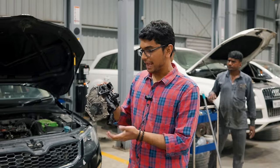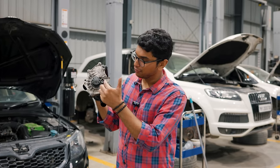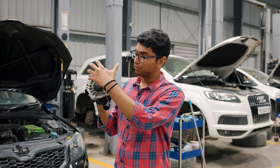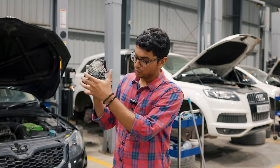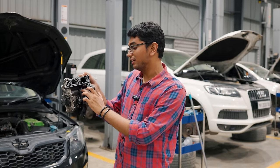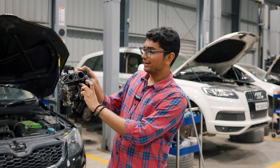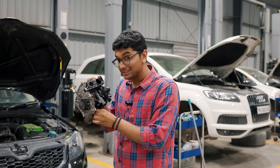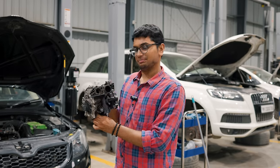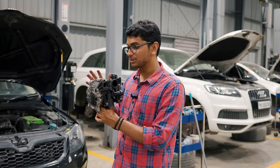For those who don't understand Marathi - basically there are two places where coolant can leak from the water pump. One is near the fins, where they've given a small slot in case there's a problem in the body, and if coolant was leaking from that side you'd see it fall directly downwards, not onto the belt. We're suspecting the leakage is from a joint on the other side. We're still going to open everything up and check for physical damage. If not, we'll just order a new water pump and see what happens.